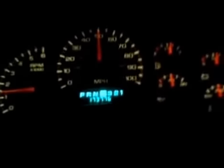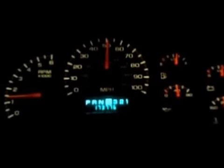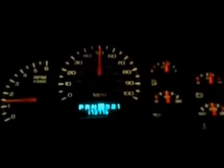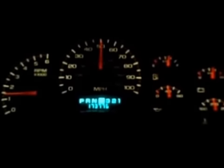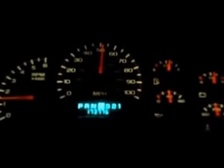I figured out what the security issue was. When I put the fuse box cover back on, I accidentally hooked onto a 10-amp fuse and broke its filament. That fuse is part of the security system — it sends the signal to the remote control door-lock system, and if that circuit is open or broken it will automatically throw a code and not send fuel to the injectors. After replacing that fuse, the truck started up.